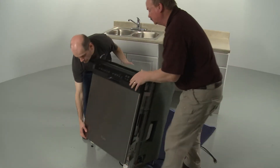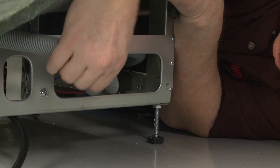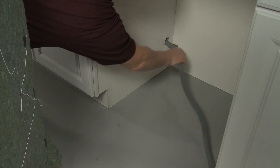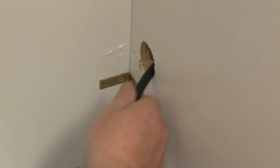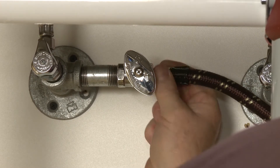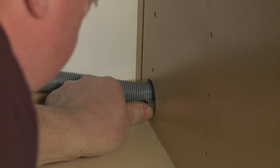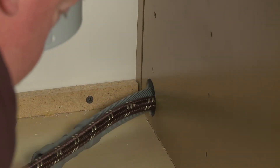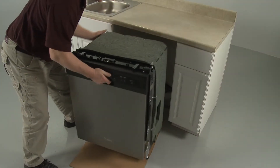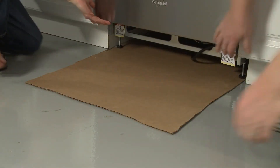Return the dishwasher to its upright position. Route the drain hose out the rear of the dishwasher and through the hole in the cabinet. If applicable, route the power cord through the appropriate cabinet hole as well. A water supply line should be connected to the home's hot water supply line in compliance with local codes and ordinances. Route the line out through a cabinet hole. You can place cardboard under the appliance to protect the floor as you gently slide the appliance into the cabinet until the four corners of the dishwasher door are flush with the cabinet doors. Remove the cardboard if applicable.